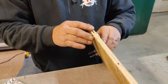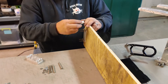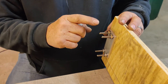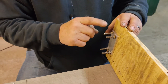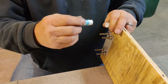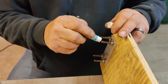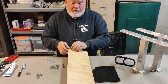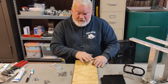Quick tip: if you're going to use stainless steel, always get used to putting some lubricant on the threads. If you don't, stainless to stainless or stainless and aluminum will gall up, seize up — you won't be able to get that nut or screw out. So we use chapstick, just low wax or something. Put a little bit on the threads and run the nuts up on there — it'll help you be able to take them off sometime if you want to.